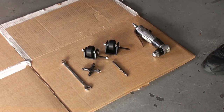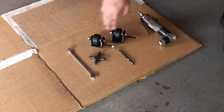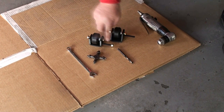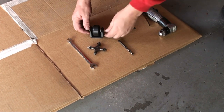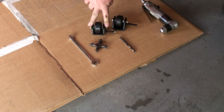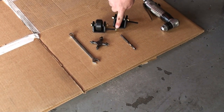What we're looking at is the nose savers — essentially the left side and the right side. All it takes to install is essentially two half-inch wrenches so you can hold it on both sides. Once you put the bolt in to assemble it, you'll use two half-inch wrenches to snug these up so the wheel will still turn, and then just one half-inch wrench to tighten it up.